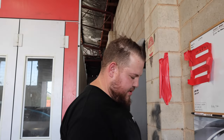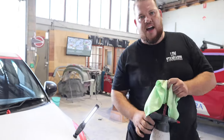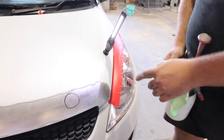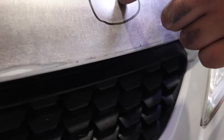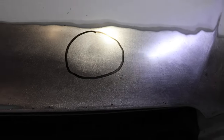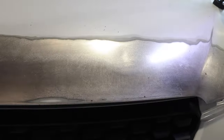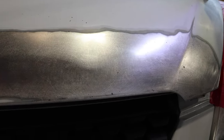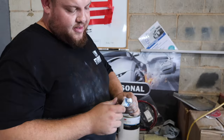We are going to mix up some bog. Come with me and I'll show you what we're going to do. I don't know if the camera will pick it up — that's why I have it circled — but there is a slight dent here. You can sort of see where it's been sanded more in one area but not another. Making sure the hardener is mixed up properly, because what happens when we don't put in enough hardener? You've got to scrape it all out.